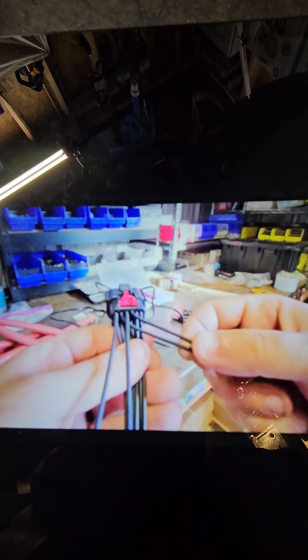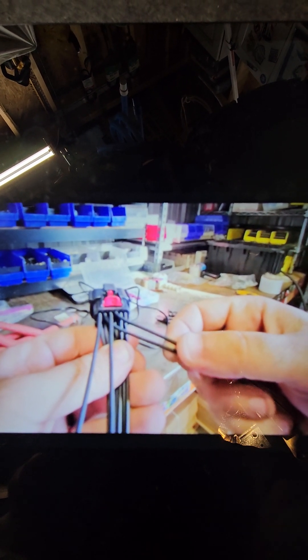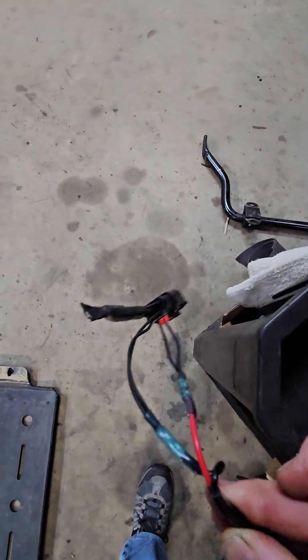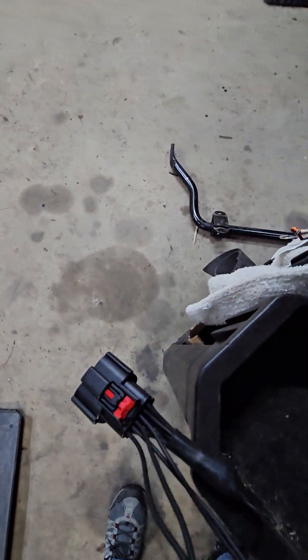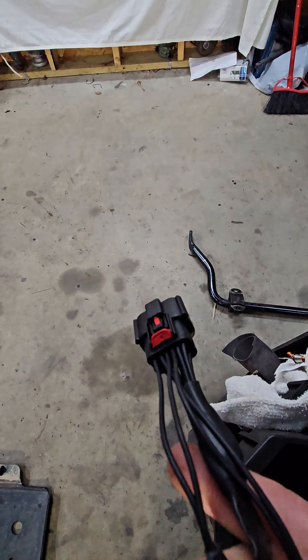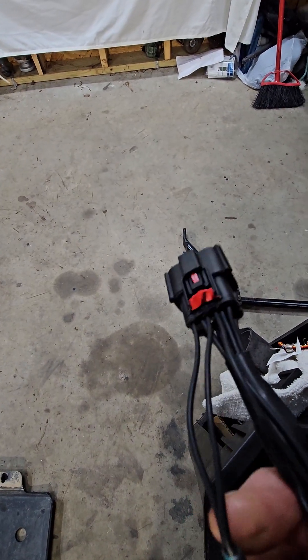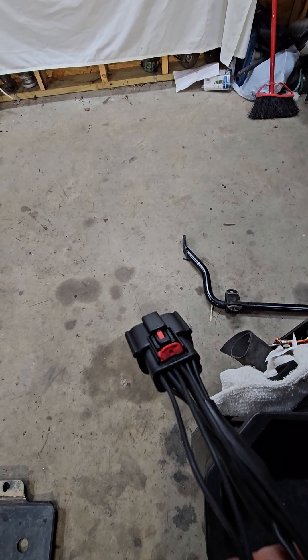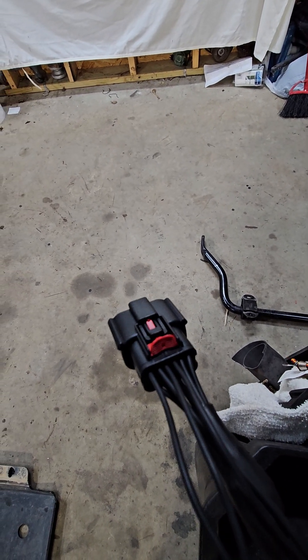From the Stinky Fab hookup, they've got it set to where there are only four wires you use — the first four on the top left. Everything else is cut loose, individually heat-shrinked, and gotten out of the way. You can see here how I've done it already. They're connected the way Stinky Fab showed it: the two hot wires going in 12-volt to the two grounds coming down the other side. There is something out there that talks about going to 6-volt instead.